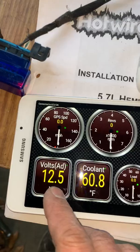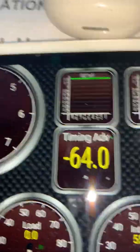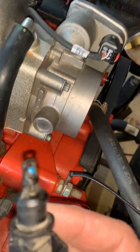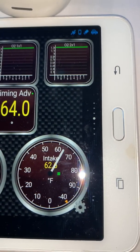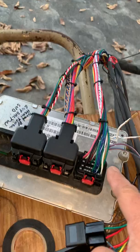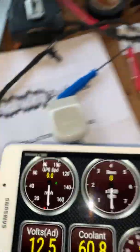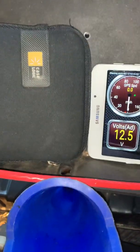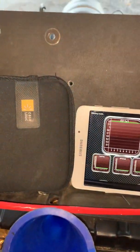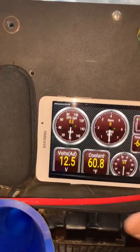These are the actual readings. Here's my intake air temperature, I've got the load set up, I've got the coolant temp, voltage is set to 12.5 right now because it's just on the battery charger. Here's my air intake temperature sensor showing 55 — I'm gonna blow on it and you can see it went up to 70 and now it's going back down. That shows it's reading off the ECU, going through these wires to my OBD2 connection to my ELM 327.